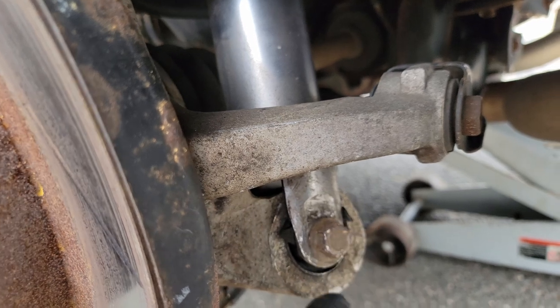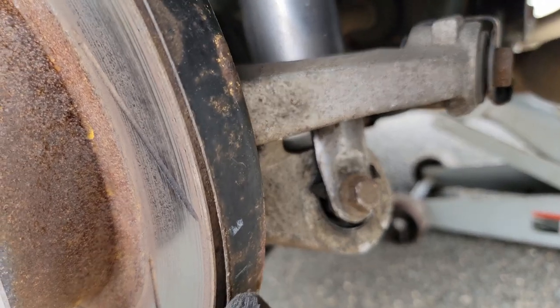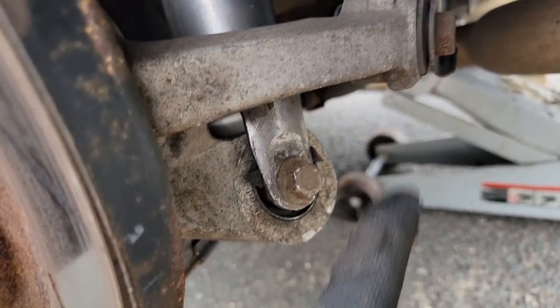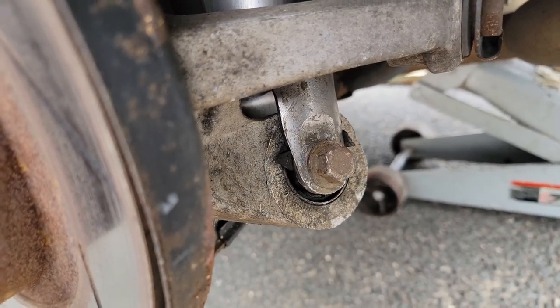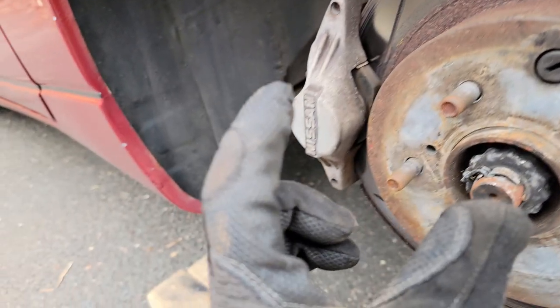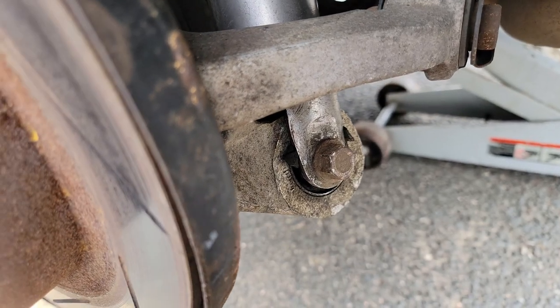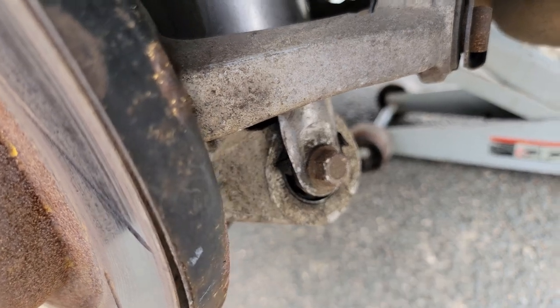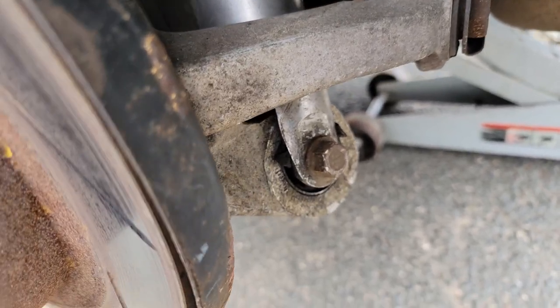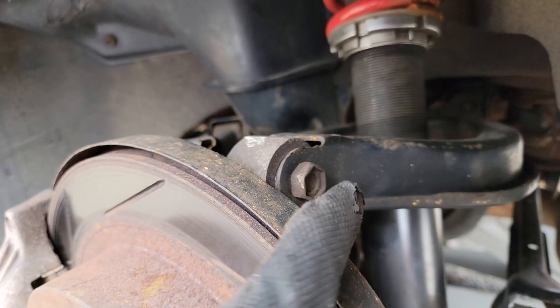How I found out there was an issue: I tried to do this last weekend, and as I was spinning the bolt head to loosen it, the entire bushing itself was rotted and just destroyed — it just kind of destroyed itself. The reason being is there's a rubber bushing and then inside the rubber bushing there's a metal sleeve. I believe the bolt got caught up — it just rusted or corroded inside that metal sleeve — so that's what caused that.